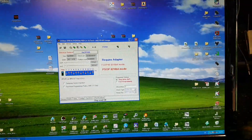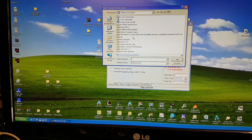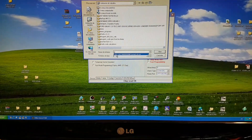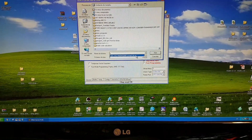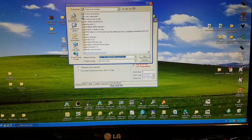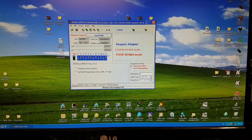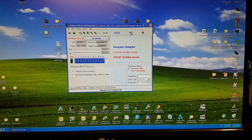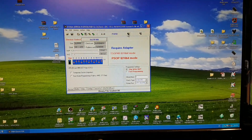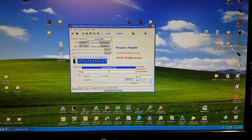I'm happy with the reading. Now we're going to write the file he sent me. To do that we press Open and look for the file — EDC15C2 tuned checksums. So it looks like someone has tuned a file for him from a similar ECU. Binary file loaded, as you can see. Now we're going to program the chip using this button at the top. I'll leave 'skip empty space' enabled so it won't write empty areas, and then start programming the chip.